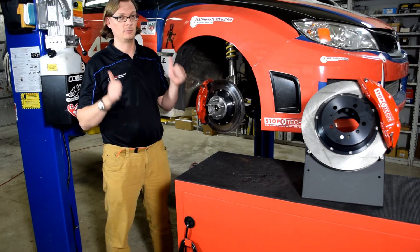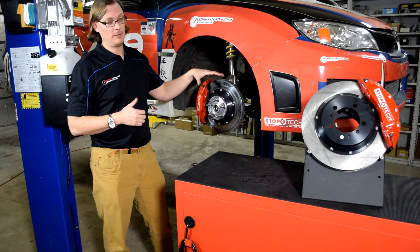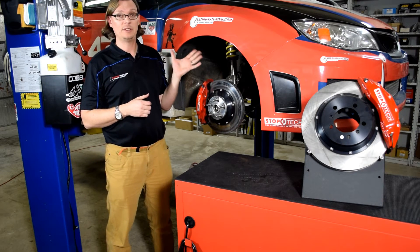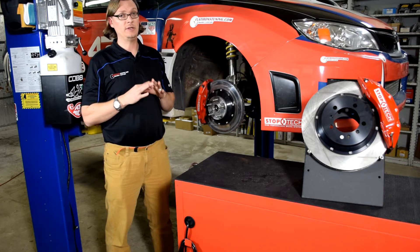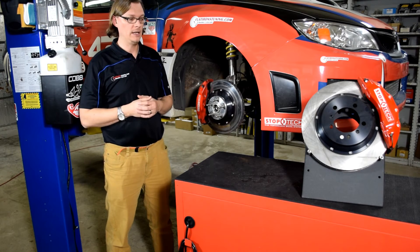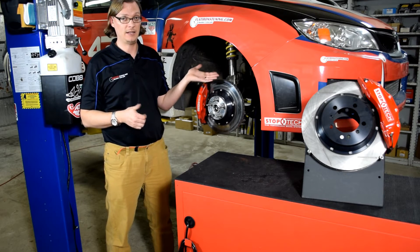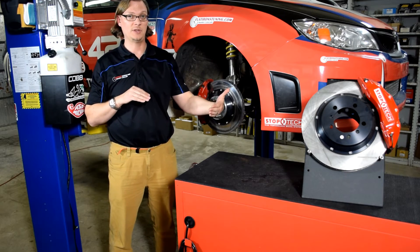The reason we increased stopping distance was a bias issue with the rears. We had increased the braking power of the fronts, but in the rear we still had stock calipers. With the 2014 WRX, the stock rear pad is very small — a unique design with limited compound selection. We were running the most aggressive pad available, but with a more aggressive pad and bigger brake up front than rear, the bias had shifted so much to the front that we actually increased our stopping distance.